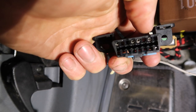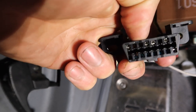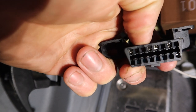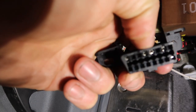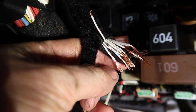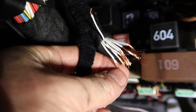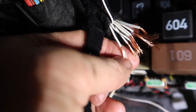You want to check between port seven and four for voltage. If it's over 12, it's got power to it. Now I'm running into a situation where I'm getting zero, so what does that mean? That means it's grounded somewhere. I've got one of my cables up here that's grounding to something, and that's not allowing it to connect to my OBD2 scanner.